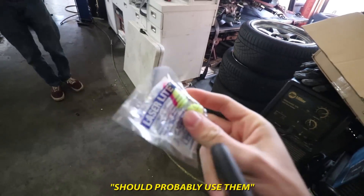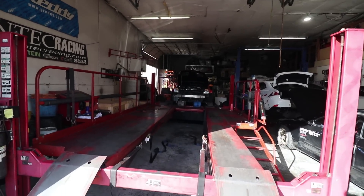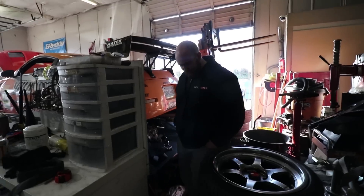Still doesn't have the front bumper because we had to get it on the tow truck. It's got some nice pops and crackles now. It sounds pretty good — better than I would've thought. So far the only issue we're running into is the car may throw an emissions code with this new setup. For some reason the combination of the Y-pipe and the full exhaust has a sensor that thinks the fuel readings are really off. But other than that, motor and everything is pretty healthy.